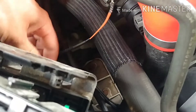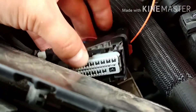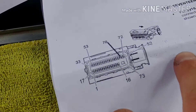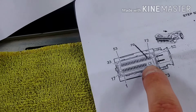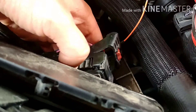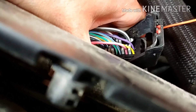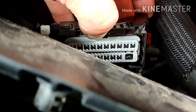I had to go to the forums to verify what I was doing. If you have any questions, go online to the LTG Project on Facebook — they are amazing at helping to answer questions. This is the front of the connector. If you look on the diagram, look for pin 73 — the first, second, third block in is what we're looking for. So this is the front of the connector, here's the big pin to orient yourself, and that means we are three pins in on the upper back. Pin 72 is yellow — skip a pin for the third pin in, and that's going to be where your pink sensor wire will go. Once you get that figured out, it's literally just reverse of how you took it apart.